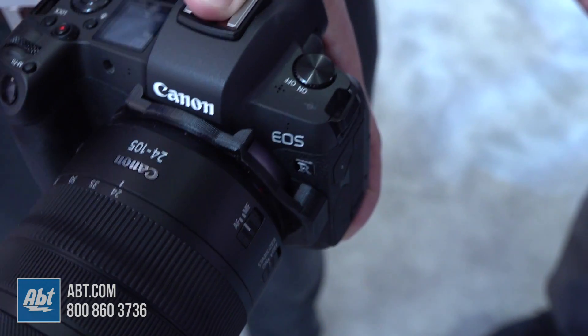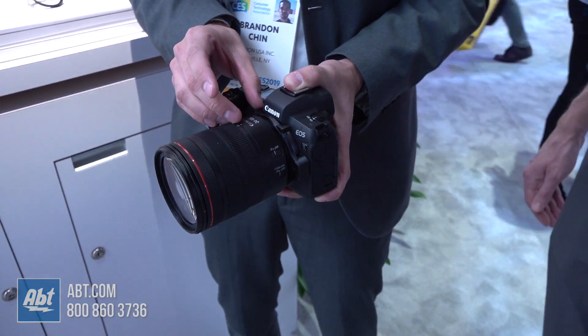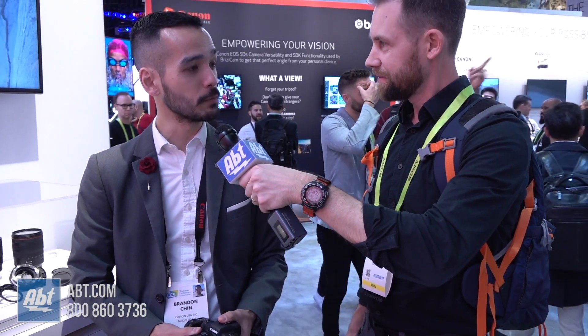They really utilize the space that we have in savings from not having an optical viewfinder. Traditionally with an optical viewfinder, you'd have a mirror there, and the mirror would actually tilt up and down. By having the available space here, we can actually press our rear lens element closer to the sensor and have a larger overall element, and that overall creates better image quality and corner sharpness as well.